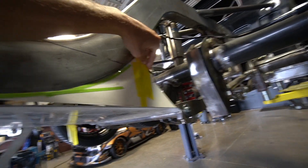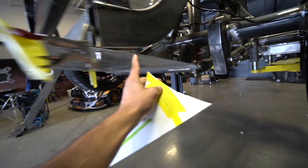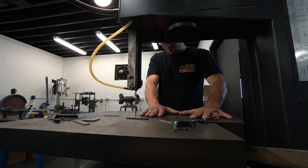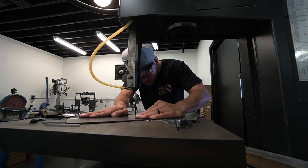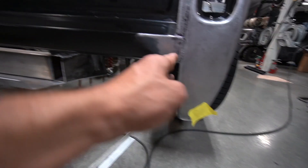I'm going to mount the middle before I start the ends. Basically what I'm thinking is having this weld to the chassis, and then this will have a broken edge right here that I can bolt this to — that'll strengthen it, and then everything else will just bolt right to it. I've got a lot of clamps going on, but I'm going to TIG weld this and then grind it because I want it to look all part of the frame — clean. Got everything clamped and flush. I'll get her all welded up, grind her down, mount this side, and then move to the other side.